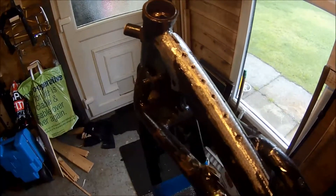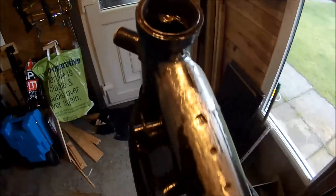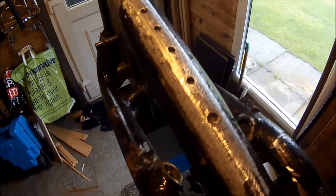Hopefully you can see - I can't tell from this angle - that all those holes, apart from the fillet at the top which doesn't match yet, are in contact so they can be spot welded. When they are spot welded and the back's done, I'll then knock that down which closes up the jaw, and weld all the way round.